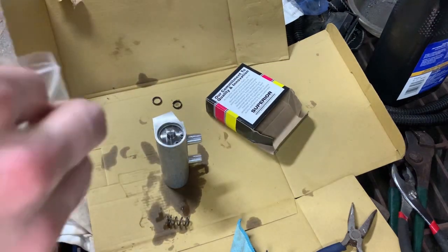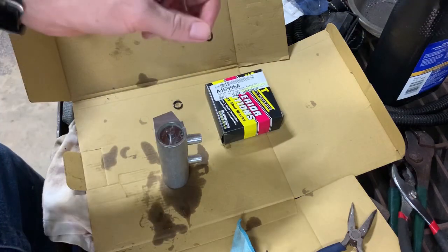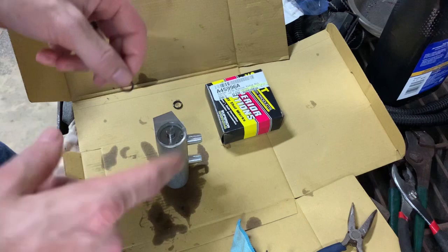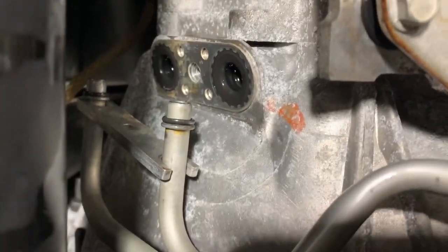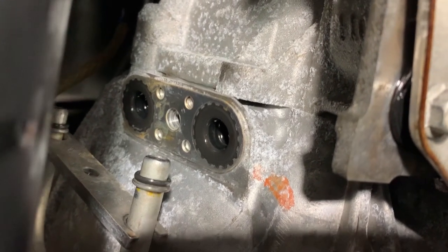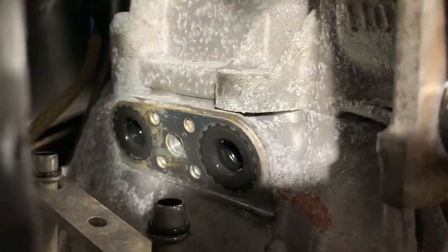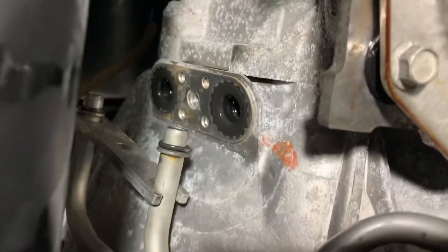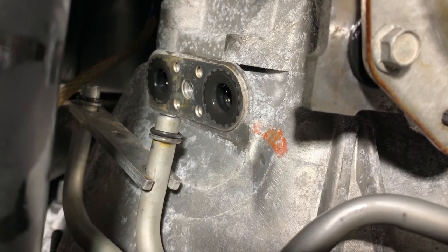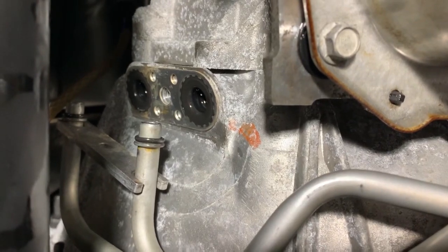Keeping the original parts in the bag and box in case I ever need them. If this kit doesn't keep temperatures where I want, I'll probably just do the drill-tap-and-plug method. Sliding back up on the lines so they can bolt in. Here's the gasket — you can see where the rubber pieces are, metal around the outside edge — one whole plate that fits up over where the bypass mounts. Put it back together the way we took it apart and top off the fluid. The torque spec for that center bolt is 15 foot-pounds.